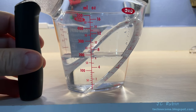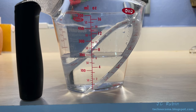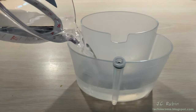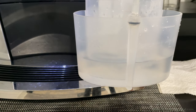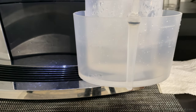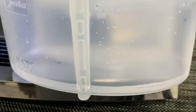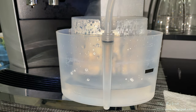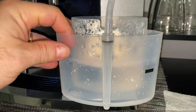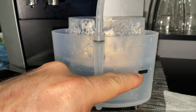I subtracted the waste water from the recommended amount and added a little extra to err on the side of caution. We'll add it to the container and run it again to see what result we get. In this test, adding that little extra left us right at the low mark by the time it finished — quite an improvement. A small piece of cut duct tape can then be used to set the new mark. Had I aligned the water level to the bottom of the tape instead of the top, it would have been perfect.